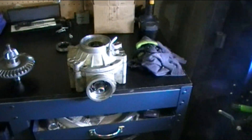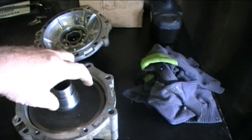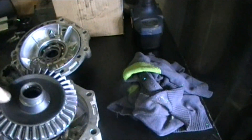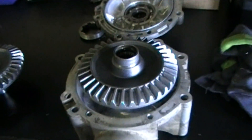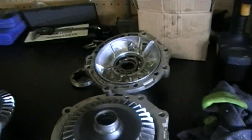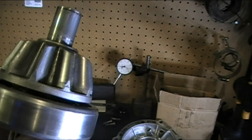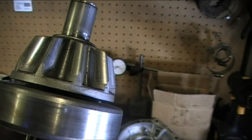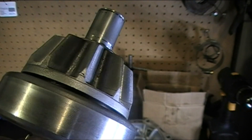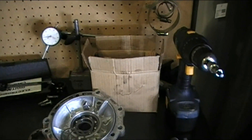Let's move along to diff number one — peel the top off here. Crown gear looks pretty good, not really even a mark on it. Get rid of the pinion here — look at that, there's a pretty little wear pattern. This was a rebuilt diff out of a 2011 Outlander, actually the upgraded Commander diff. See some nice little wear patterns. This differential only had 250 miles on it — 250 miles and wearing already.